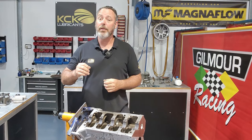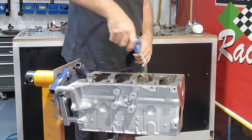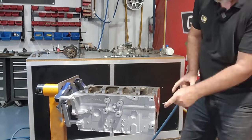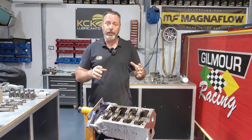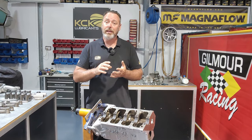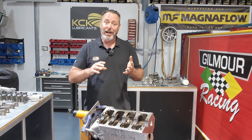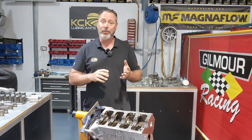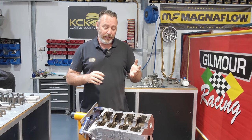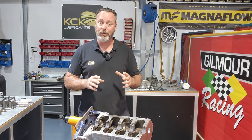With those main caps removed it's time for the last visual inspection before components start being fitted. Grab the airline, blow it out, make sure this thing is absolutely spotless - get rid of any contamination ingested during that dummy assembly. Make sure the crankshaft is clean. While you're blowing out oil galleries, make sure your compressor air is filtered. I've seen guys with compressors spewing out oil or water blow out an engine and pump more contamination in than was there originally.